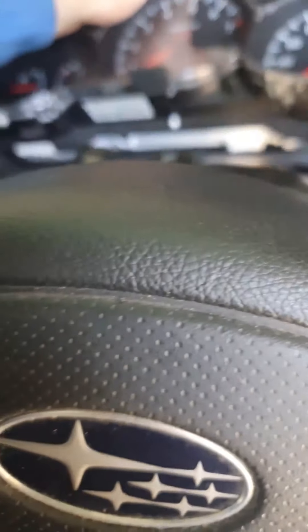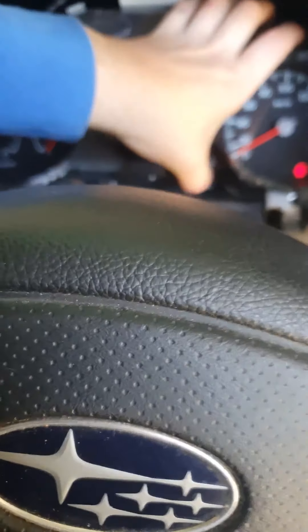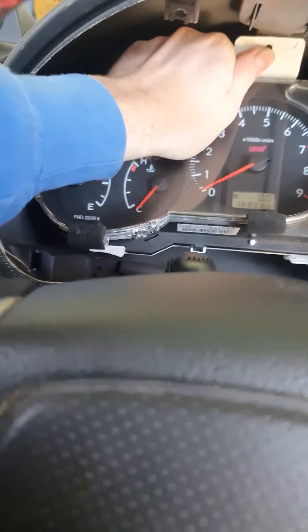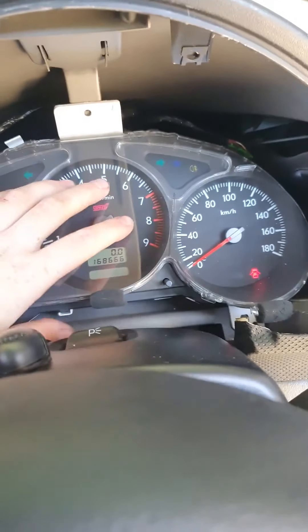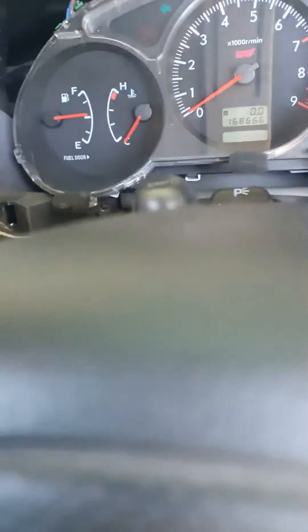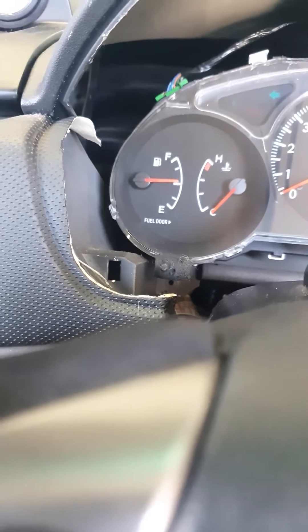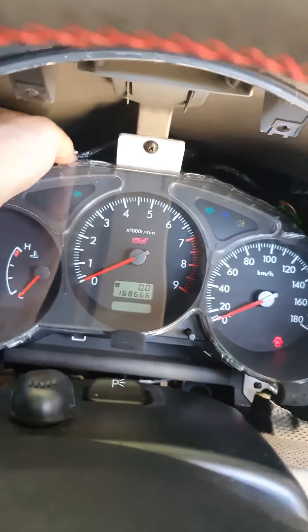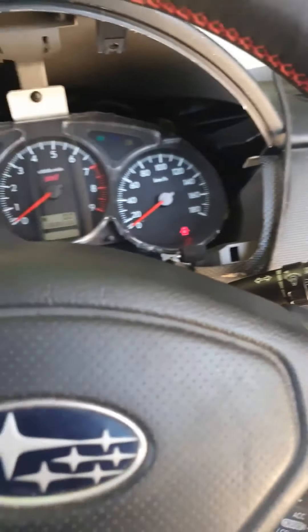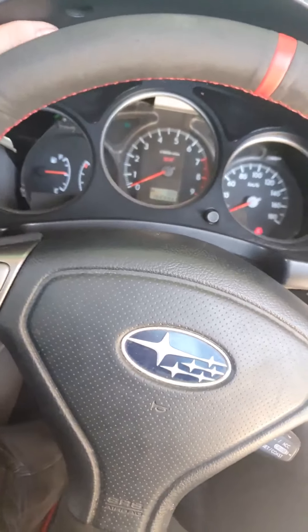Put those three connectors in, just move the cluster back into position, get it into the little grooves, and try to get it up in that spot perfectly. I haven't got one tab down here but it should be alright — if you just mount it nicely it should be perfect. So get that screw back in down here, this one which I don't have, and the one up at the top. After you've got those three bolts in — one down there, one down there, then the top one — you'll just get your face shield and basically do what you did to install it in reverse.